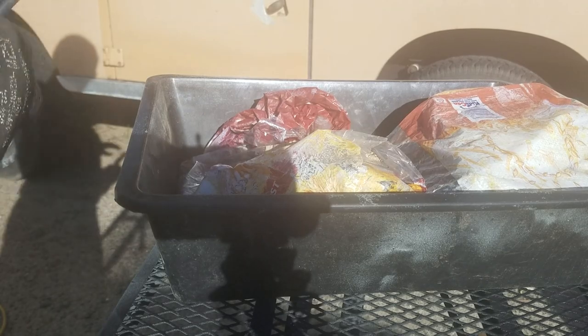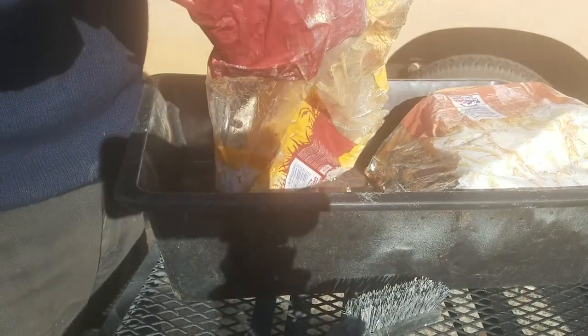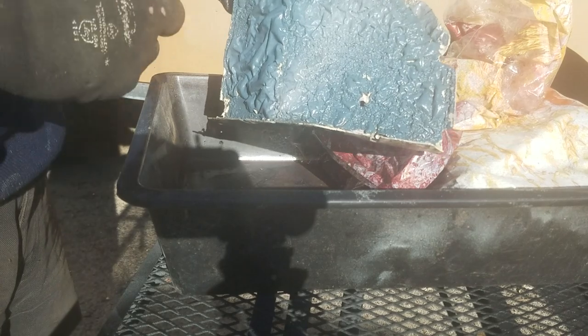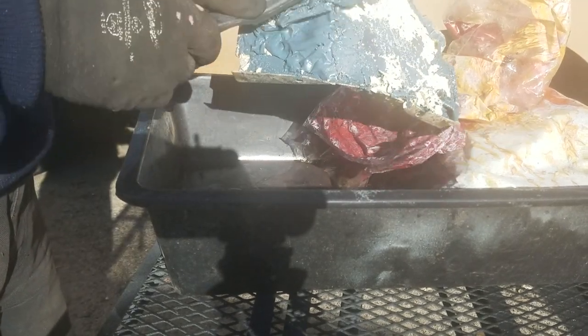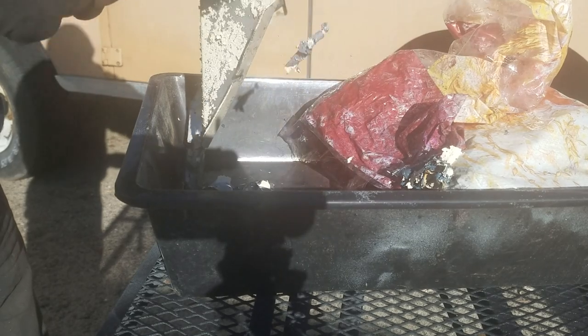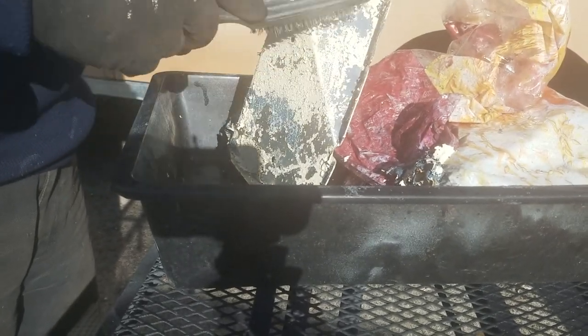I've been bread bagging again. Not tea bagging, bread bagging. Bread bagging's my way of cleaning paint off small parts without any labour at all. I put a little bit of lacquer thinners or strong paint thinners in the plastic bag, put the part in, and just leave it for 24 hours in the warm sun, and the paint just drops off. I haven't had much luck with paint stripper, so this works just as well, saves me buying the stuff.